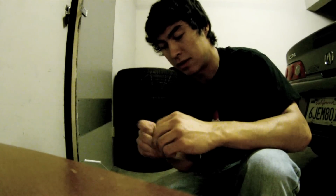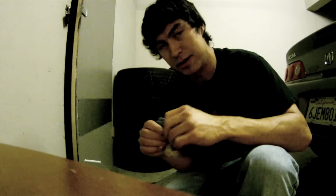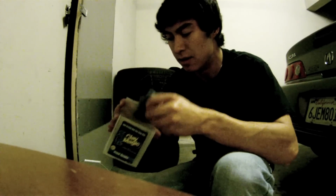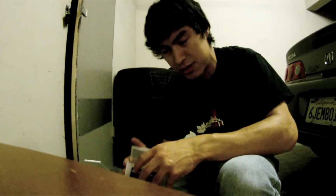One last thing I forgot about the clay. Don't forget to get the little places in your car that you might miss. Door handles and mirrors are the places that I frequently forget about. Also the roof, sometimes it can go neglected. Don't forget about that. Okay, last step to claying, just make sure that the clay bar is on a good surface. And when you put it back in the box, just drop it in and spray a bit of ONR on there. Keeps it from getting stuck to the box.